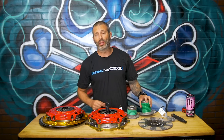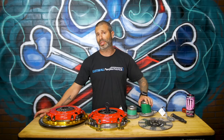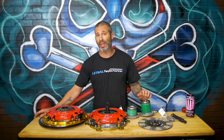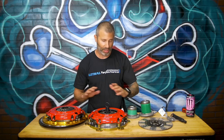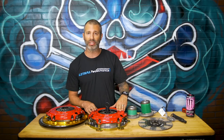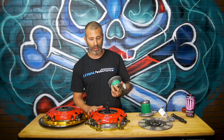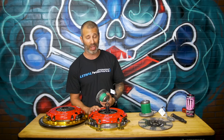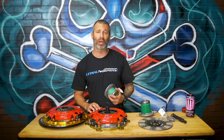That leads us into the conversions for the TR-6060. On 11-and-up cars that use the MT-82 where the customer wants to do a TR-6060 swap for the stronger transmission — and it also converts to a 26-spline setup — we have a specific setup for it. For any guy who has an 11-and-up 5.0 with an MT-82 and wants to go with a TR-6060, we're going to treat it just like a 10-and-up GT500. That means for that assembly, you're going to go with the 6975-07M or 07HD and the short bearing. The reason is that you need the proper depth and engagement of the clutch, the right bearing, and also that this clutch is a 26-spline clutch because the TR-6060 is 26-spline where your MT-82 is only 23-spline. Give us a call and we will help you walk through it and make sure you get the right stuff.